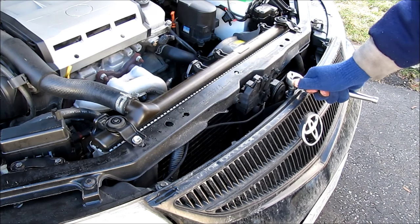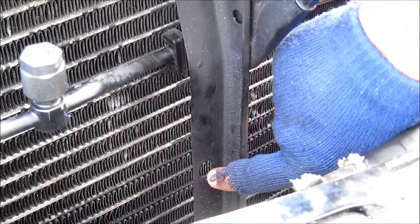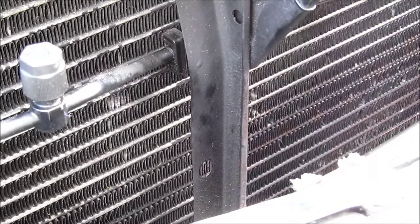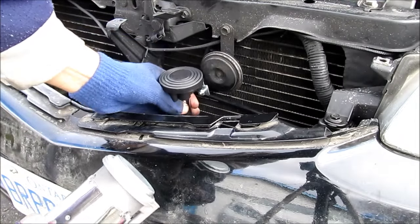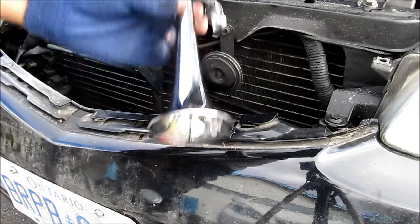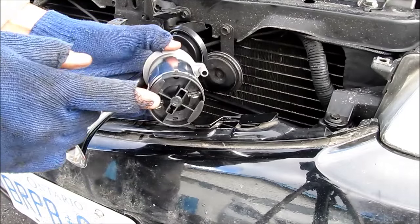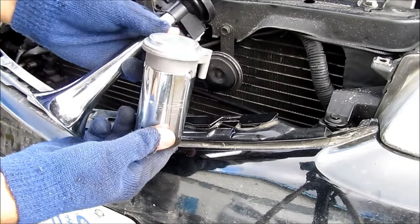To get better access I'm going to need to remove the grill. I'm going to be using this pre-existing hole in the rad cradle as my mounting point and mounting the air horn kit inside of here. Because this is cheap plastic I don't want any water going inside, so I'm going to be mounting this facing downward. Same thing with the motor — there are electrical connections at the bottom so I'll also be mounting that facing downward.